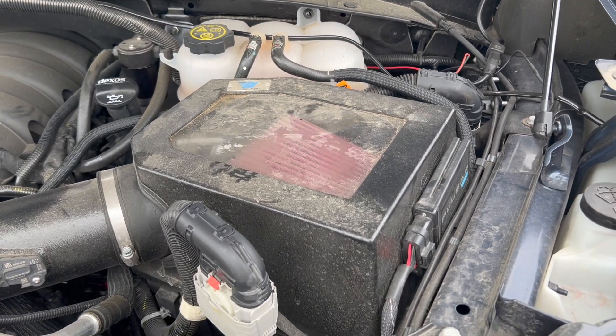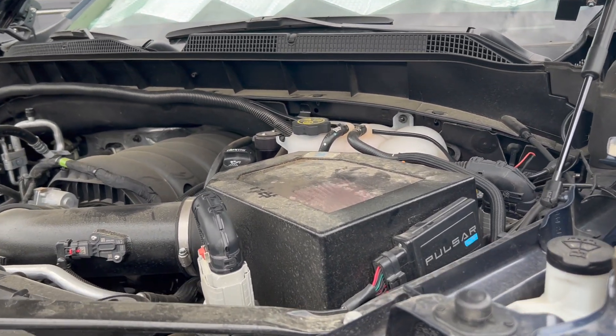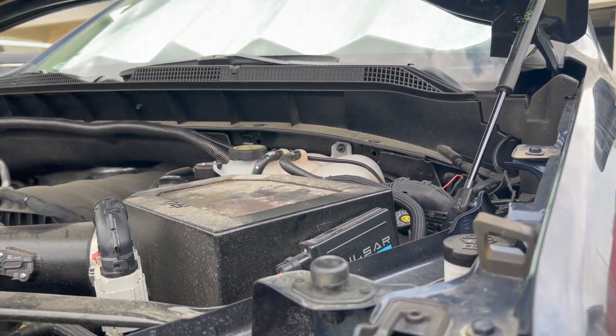My favorite mod of all, which I've mentioned repeatedly, is the Pulsar LT — it shuts off the DFM, the Dynamic Fuel Management system. On our long road trip, she didn't have to worry about the engine running in the 17 different cylinder variations. It shuts off DFM, AFM is shut off, and we increased throttle sensitivity — I think we're running level three, which is my favorite. Ultimately the truck runs a lot more efficiently. She hit those records on cruise control at 65 the second day, drafting behind the 22-foot truck.